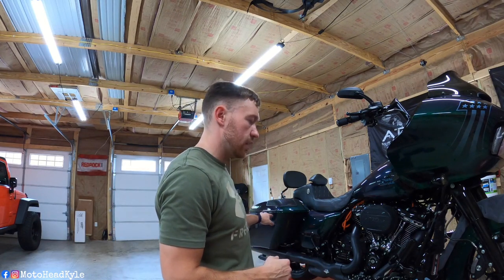I'll pop a card. Now, obviously, if you're just doing a general oil change, now's the time you would just go start your bike and let it run for 2-3 minutes, check your levels, top them off as needed, and then go take the bike for a ride, make sure everything is all hunky-dory. But now, since I'm doing a 10K service, I'm gonna more thoroughly go over the entire bike.